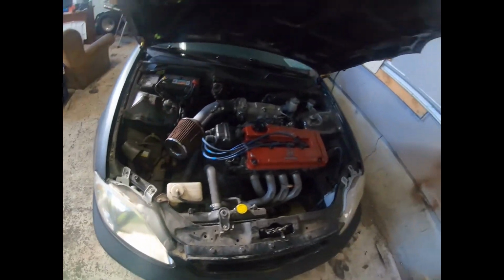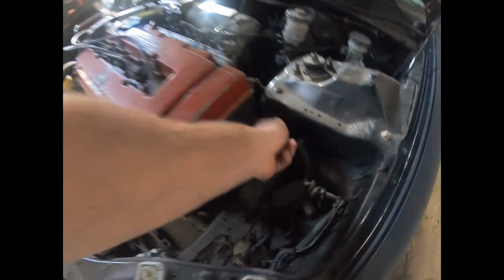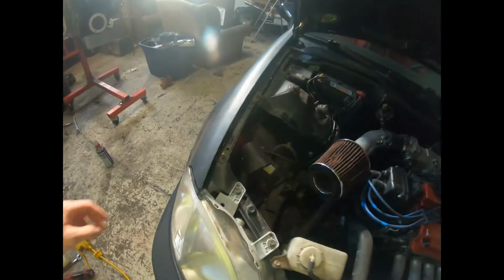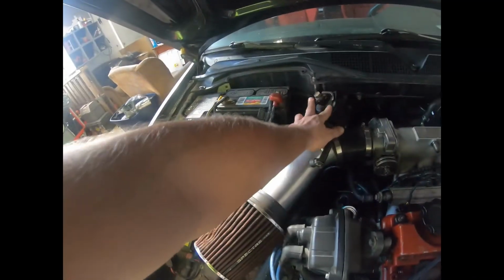So we gotta pull the swap out, we gotta sand down the whole bay, we gotta pop the fenders off and the front bumper, sand those, paint those, and then we have to rerun all these wires. These are for the headlights, so we're gonna rerun those on the side of the fender, and then we're gonna reroute all this alarm stuff, and then we're gonna have to, of course, delete some things. We're not gonna be using this fuel filter no more, so that's gonna get deleted.